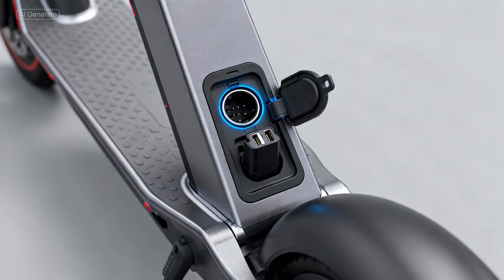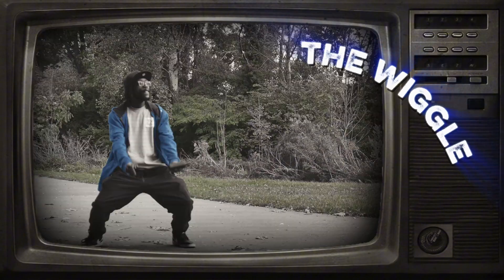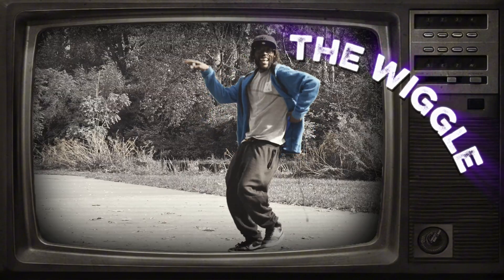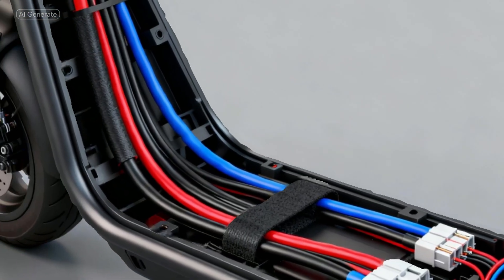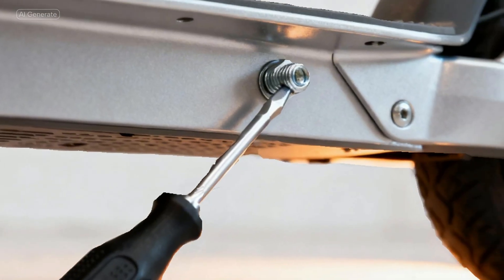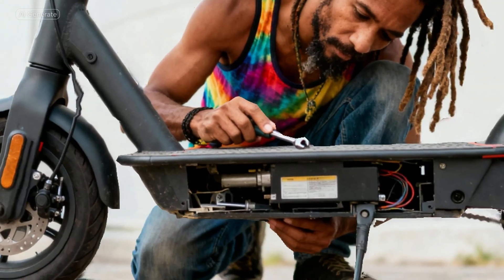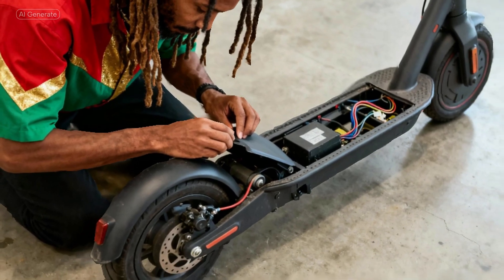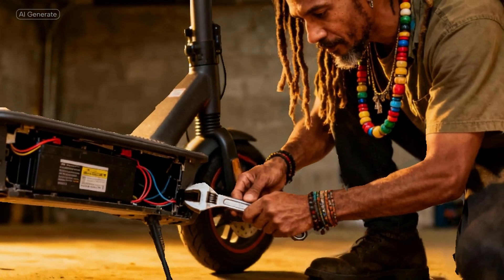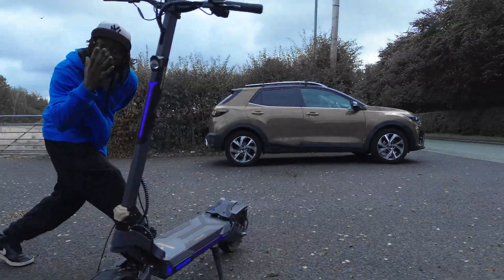Deep dive if you're brave. If it never goes red no matter how much you wiggle, it might be the wires inside. Grab a screwdriver, pop the bottom panel off — lefty loosey on the screws, you know the ones. Look for the red and black wires leading from the charging port to the battery. Burnt smell? Melted wires? Yeah, that's bad. Repair or replace them.